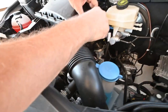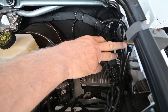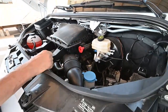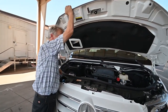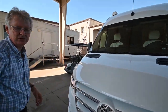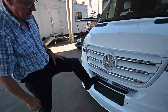We also have a jump start for the chassis battery that starts the engine. You put the positive here and over here, and the negative here on the frame - that's how you hook up to do the jump start for the battery if you ever needed to. To lower this back down, the maintenance on this is 20,000 miles or one year, whichever comes first. We actually prefer you go to Mercedes for the first few times so they can hook up their scanner and check for any kind of recall data or safety bulletins that might be on the unit.